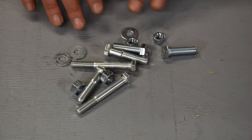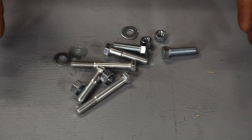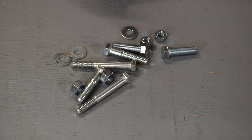The last couple of gripes: the hardware is junk. This is the cheapest grade 5 stuff you can get — plain nuts, not even a nylock, not a Stover distorting thread-lock nut or anything like that. The difference in price is pennies. Get some decent grade 8 stuff, get some Stovers, get some real hardened washers. It costs so little but makes a huge difference — I would never install this stuff. And likewise, the instructions: out of all this, there are a couple of grainy pictures of how to grind the oil pan. We live in a world where every phone has a camera that will take better pictures than these. Take some decent pictures and include them. Do I sound like I'm ranting? I am — because this is unacceptable. This is the quality you're going to get if you buy from Mercedes Diesel 4x4.